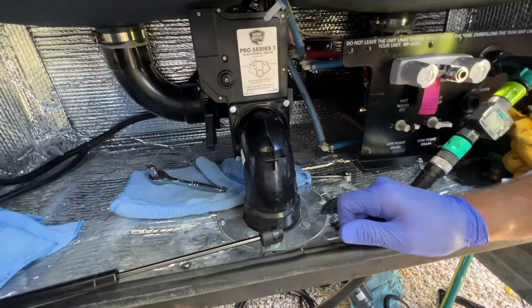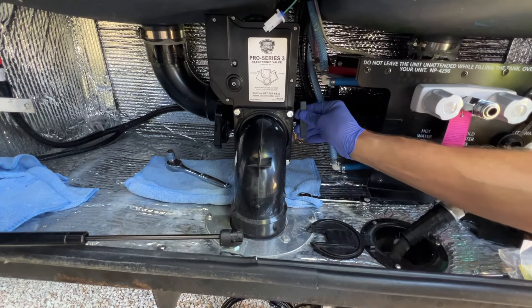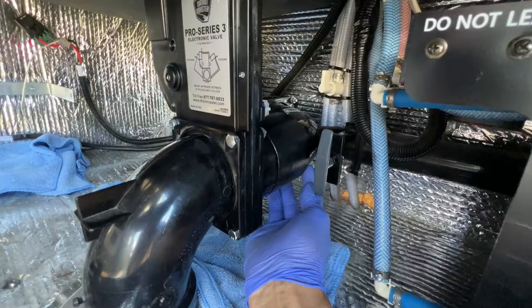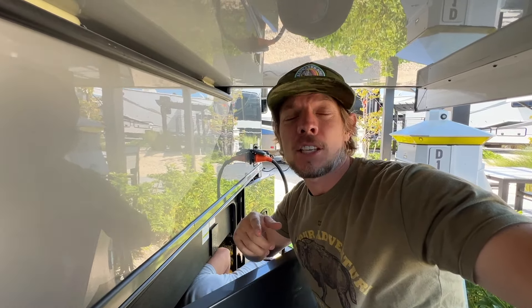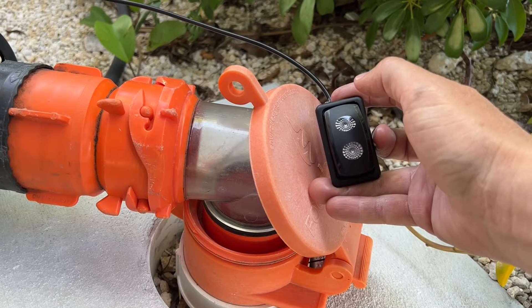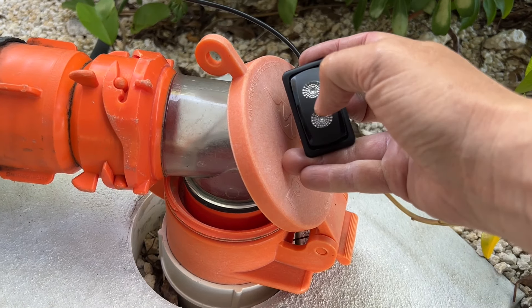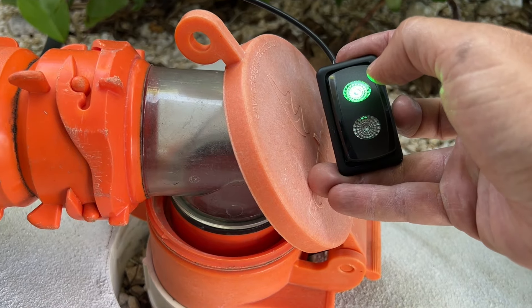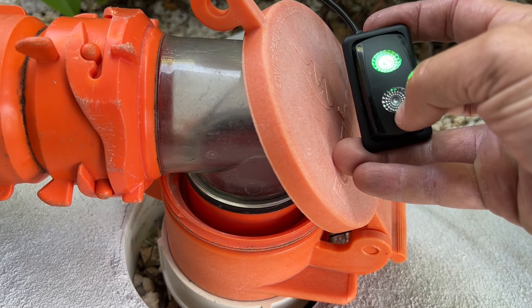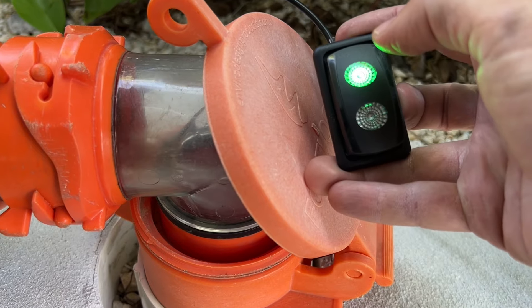Calibrated hands. We're going to do a quick leak test — pull a little bit of gray water, just shower or sink water — to make sure there's no leak, then close it up. If we were going to get any leaks it would be right around this valve. They emphasized strongly not to go past 10 foot-pounds of torque, but said you can go to 15 if you are seeing leaks. If you go to 15 and you're still seeing leaks, contact them. We have our valve in place and the remote is right here. Use these clear plastic unions so you can determine what your tanks look like and how clean they're actually getting. Green light — that's pretty sweet. So freaking cool!